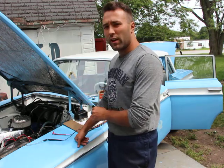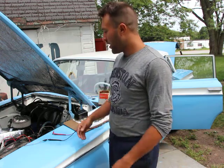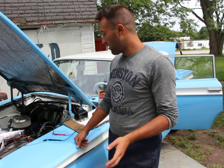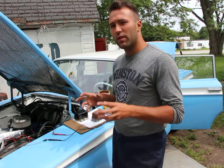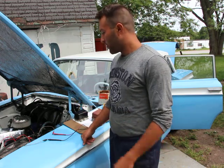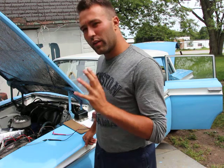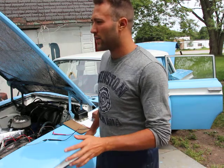As soon as I rebuilt the engine, I could not turn it by hand. I mean, I could, but it required a lot of force. Now, after maybe 80 kilometers or so, maybe 100, the engine is turning fine by hand. So it's just those new rings sitting into the cylinders. And when the engine gets hot, everything is tighter, right? So that's why it's absolutely imperative that you do not overheat a rebuilt engine. No engine, but especially not a rebuilt engine.